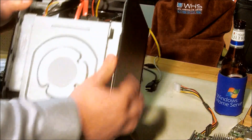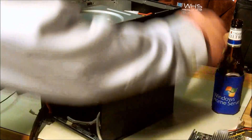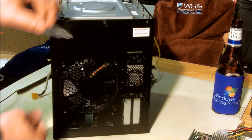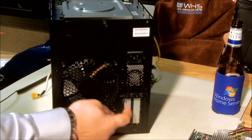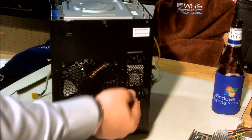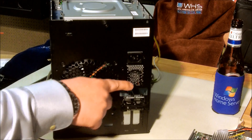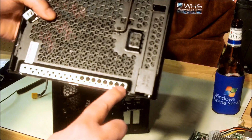We can leave the door off. Now that everything's open, we have full access to the server. Being careful of all the cables, we're going to go to the back. On the backside, we have access to the two PCI ports. To access them, all we have to do is push down here and this little panel pops off. Now we can pull off the slot covers.